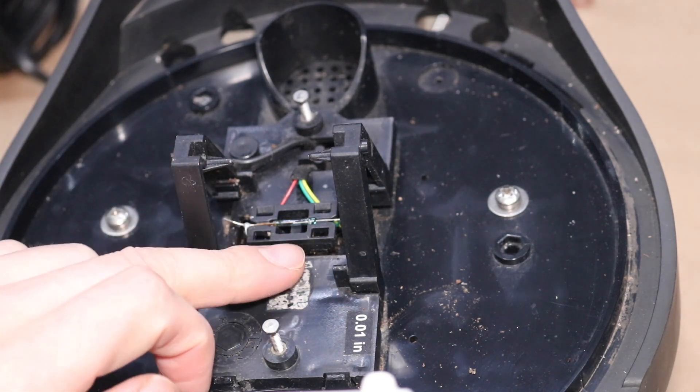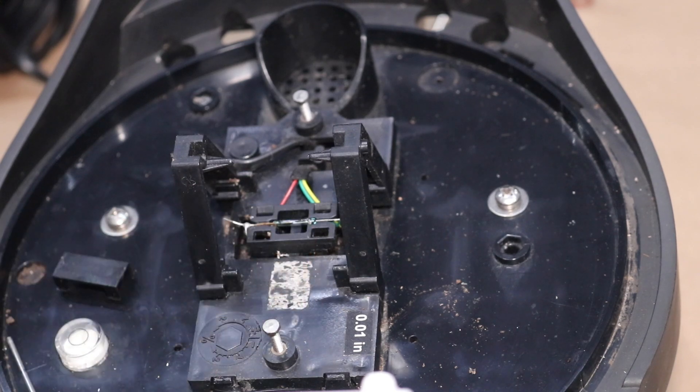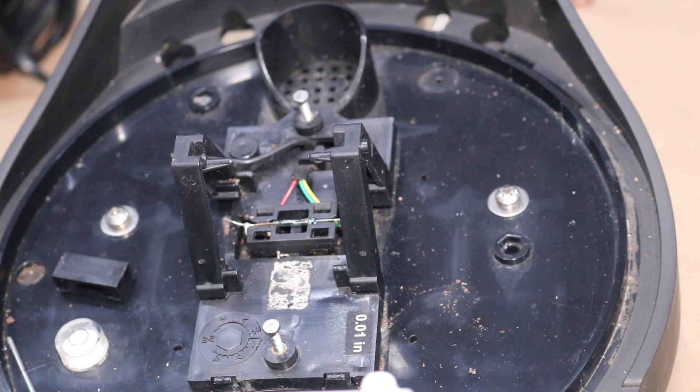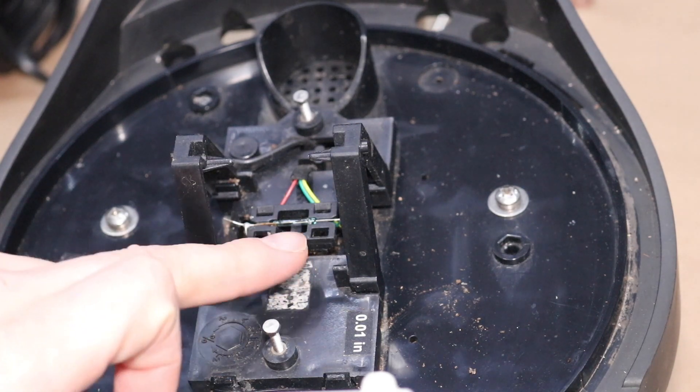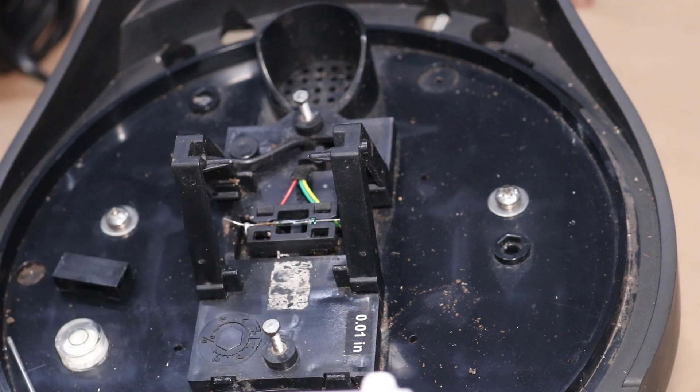I'm going to use just the regular glass filament ones because we have this little plastic cover. These reed switches are apparently pretty sensitive, so it's pretty common for them to fail. We have some replacement ones for the future, but at this point I'm going to go ahead and remove this old reed switch and solder on the new one.